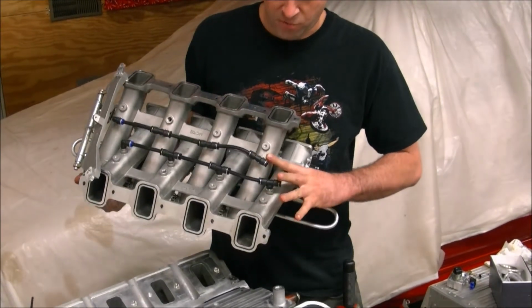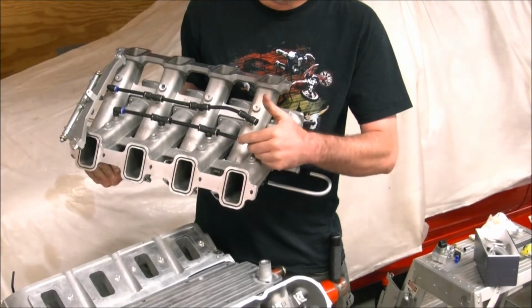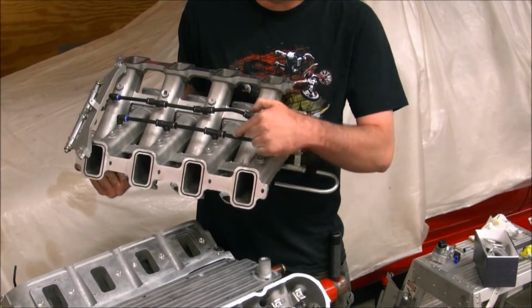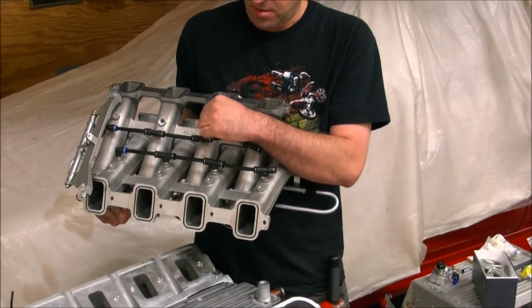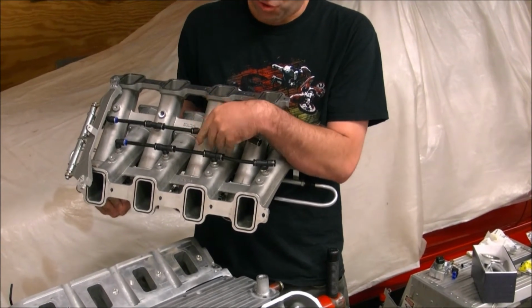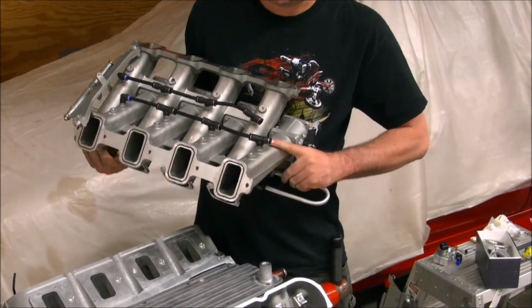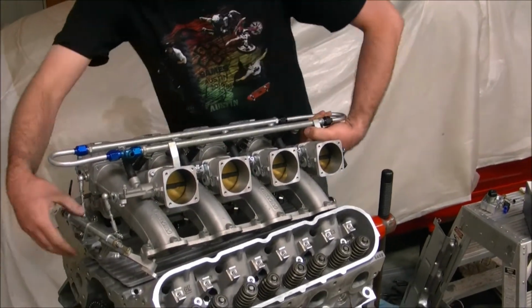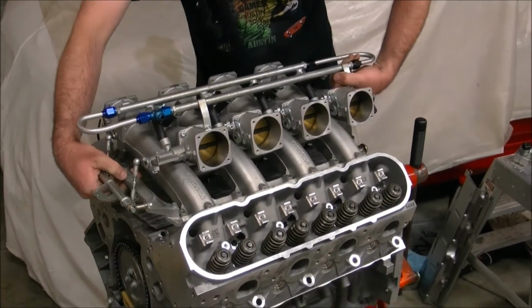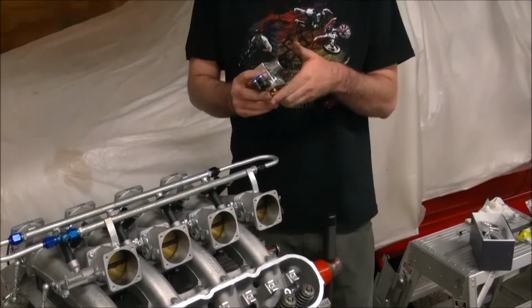So I've made up my own air fitting for a manifold, an air manifold, so I can run idle air control. I used bigger line than what the inlet size is on the intake, so hopefully it won't just feed one or two cylinders. So that's what I got rigged up there, and then I spent the last 7 hours today making up an idle air control valve.